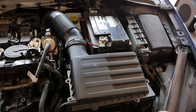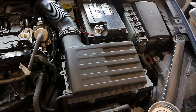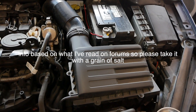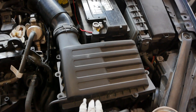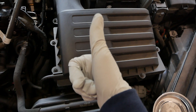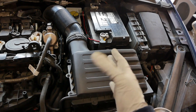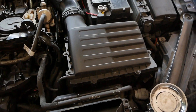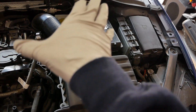By removing that snow guard — if you haven't seen it, I'll try to put a picture up — it's basically designed for snowy environments to help prevent dirt getting into your intake. But as you can see it's pretty restrictive in terms of airflow. I live in California so we don't get much snow — boom, take it out. It's really simple: there are T25 bolts all around that can't back out, so you'll never drop them into your engine bay. Once you remove the filter you'll see the snow guard at the bottom, just rip it out. Replacing the OEM filter with a high-flow panel one does help a lot for sound, especially inside the cabin, though it's not going to be as loud as a full open intake system.